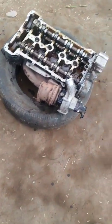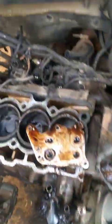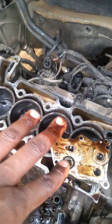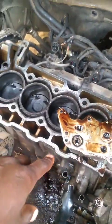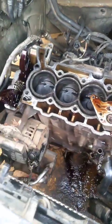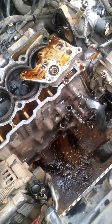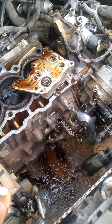It's really difficult to tell where this is happening. The suspects are: the turbocharger, the engine oil cooler, and the transmission oil cooler. It was not the head gasket that caused this — the head gasket was a reaction to the overheating. We'll start by replacing the engine oil cooler and the transmission oil cooler first and see what happens.